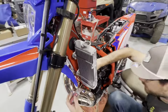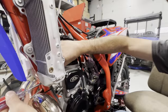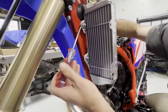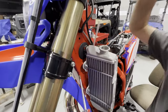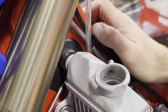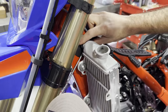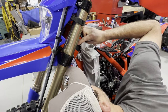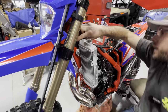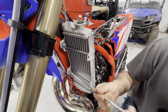These clamps are accessed from the front, so pop the white louver out of the way — forward pressure pops it right out — and here are our two bolts exposed. But first I'm going after the clamps. I like to get them as loose as possible so the clamp doesn't work against you. I'm going to take this clamp completely off and slide it around the corner. This second one can be tricky — you sometimes need a super short phillips screwdriver — but Beta put it in a decent spot on this one.